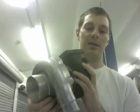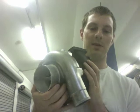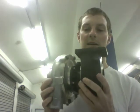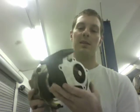To give you an idea, if you're looking to do a rebuild on this, watch my PTE 6176 rebuild video and I'll show you how to go through the whole rebuild with one of these. The only thing you need to know is you might need to replace the shaft. If you do, the exhaust housing might as well be machined because the turbines are basically impossible to get. If you need this service done or need parts, you can always contact us at TurboLabAmerica at gmail.